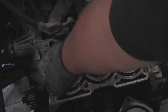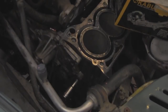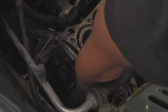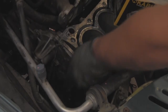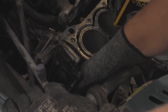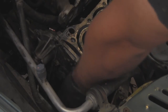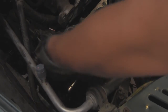Now I'm going to see about removing the water pump over here and replacing it. Get the camera all situated. As you can see here, I have this socket on this long nut right here. I've got to remove this spring-guided mechanism, or at least get this part off, so I can pull the water pump out. This looks like it's going to be the most difficult one. Unfortunately, I can't get the socket on there just by itself — I have to take the socket off, put it on like so, and then put the socket on. So let's go ahead and do this.